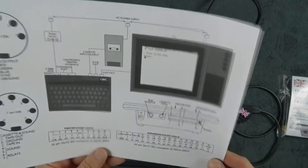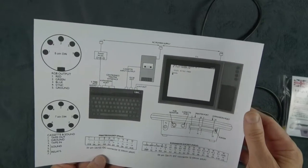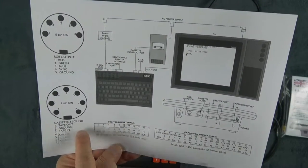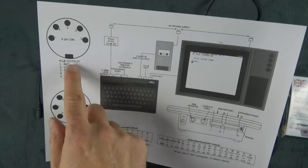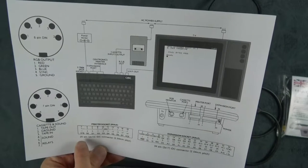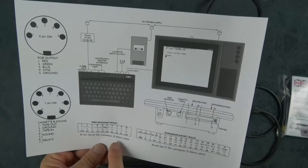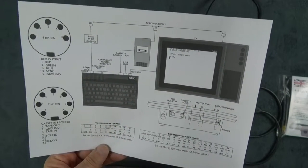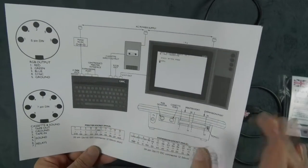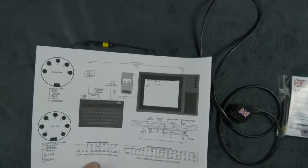So I made an improved schematic. I'm going to link the picture in the description. If you want to make your own cables, you have the entire pinout, so this is the RGB output. This is the cassette and the sound output. The printer, which is a 20-pin 2.54 millimeter pitch, IDC format. The expansion port is 34-pin. That's about it for the connectors.